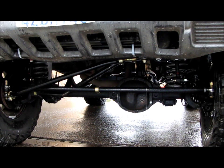So the problem with that was, on these Heim joints on the Iron Rock Offroad over the knuckle steering kit, there's some lubrication on those joints, but not much. They're not covered in grease or anything like that. So what happened was I pressure washed all the lubrication out. Then I went for a drive, and I was going, man, what the heck? Did I bump my caster out of adjustment again? Because it was doing the same stuff where it didn't want to drive in a straight line again.